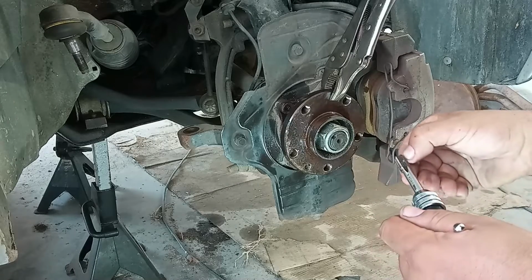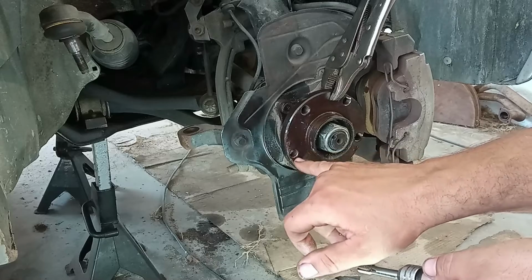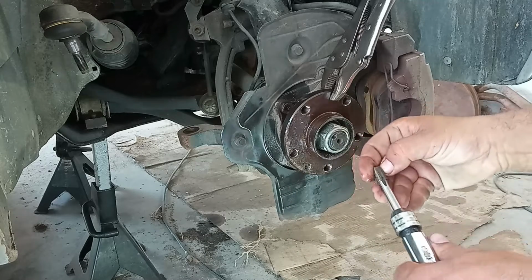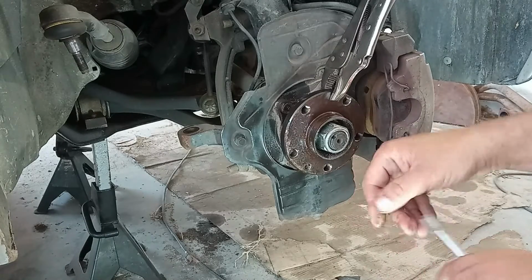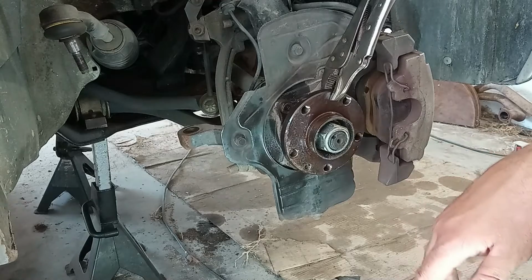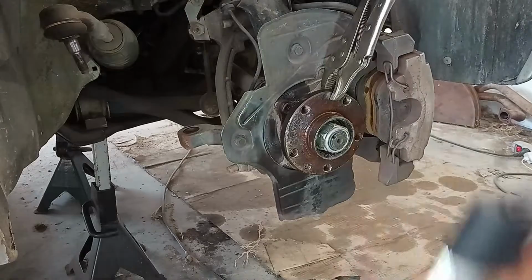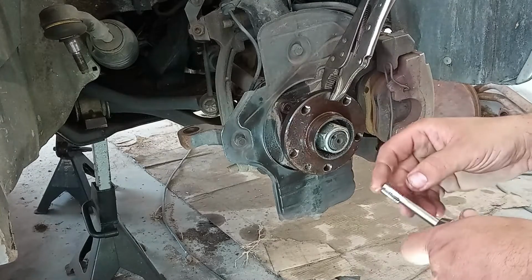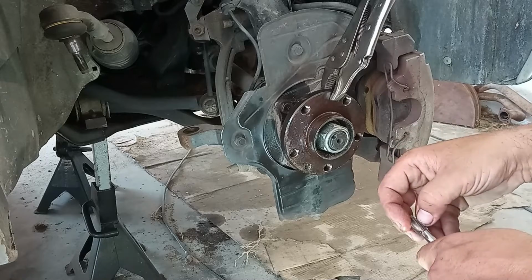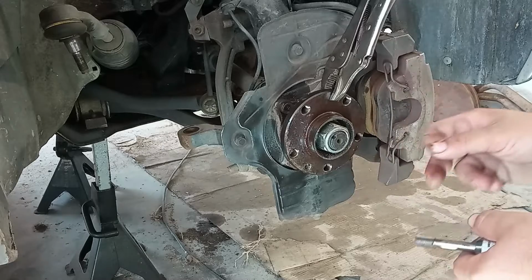Talking about the repair with helicoils, I do not advise doing that over here. It is very risky. You just have 5 bolts holding down the wheel. If you have 2 or 3 repairs in this case, maybe all of them, I think it is too risky. Possibly not, possibly it is even better. If you have an insert, yes, that may work. But the helicoil itself may be a little bit weak.